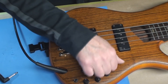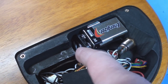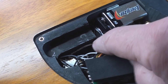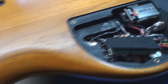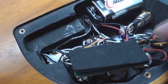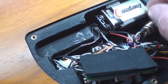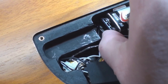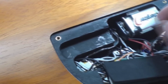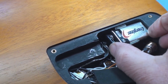Let's put the battery back in. Now that I look closely I see something that could be an issue. There's a big ganglion of ground wires that aren't covered up, and then we have the battery which sits in there like that. The wires should go in that direction — that's the plus side of the battery. There's a chance that battery could have come in contact with those wires if it's not pushed back in the hole properly. I'm going to cover that up — that could be what's going on.